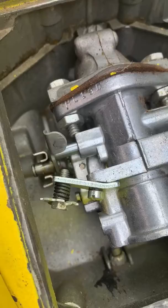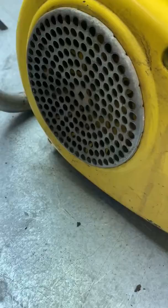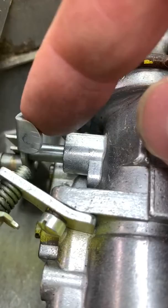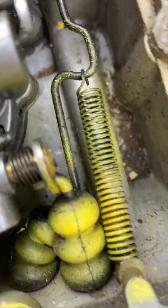This is the speed governor — see how it moves and kind of slows up? There's another arm down inside here. The fan off the flywheel: if you hold this — see, I'm holding the throttle — see that? That's closing the butterfly. So from down inside here it comes up, we get wind, and then it closes the throttle. That keeps you from over-revving it. And here's the governor right there.